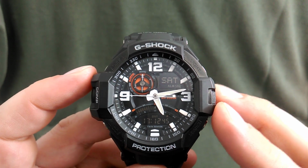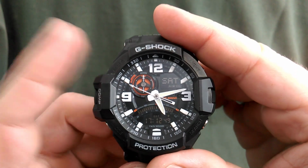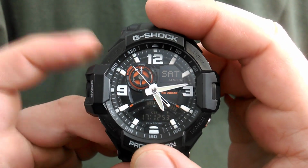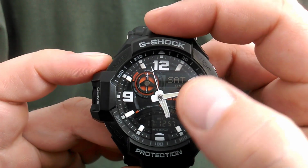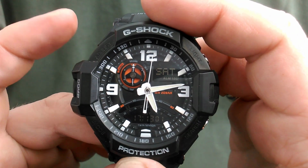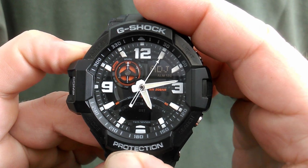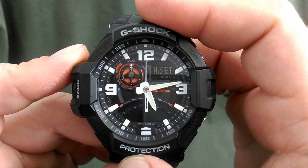If you notice this, you just need to do the recalibration of the hands, and you do it by pressing and holding the adjust button, but not 3 seconds to get into the adjust mode, but you keep holding it for more than 5, and then it's going to display HT here, I believe. Or HS, hand setting. So press the adjust and hold. First it's going to offer the adjust, but you keep holding, and now it's H set, hand setting mode.